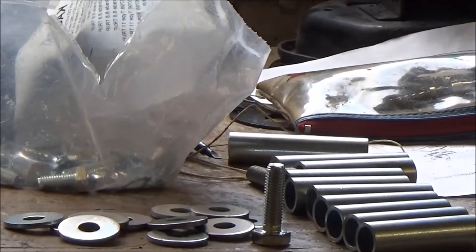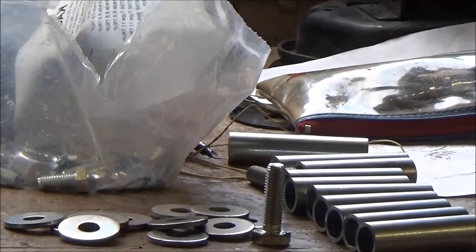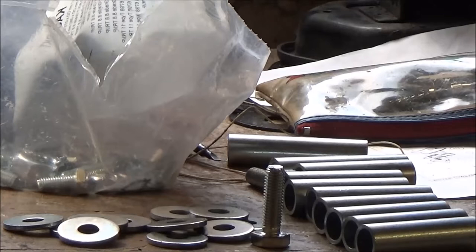Some bushings are over here on the bench — there are eight bushings. They just drop into place and then you put the bolts through. They support and stop you tightening up too much and bending the chassis rails, because they're only normal car steel, nothing special or heavy. Going back to the old MGBs — they had some heavy chassis rails, sort of like a subframe off the castle rails and sills which help to stiffen everything up, especially on the roadster because it's a soft top. Car technology has moved on a lot.